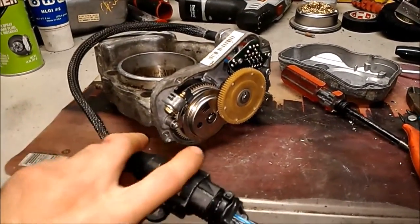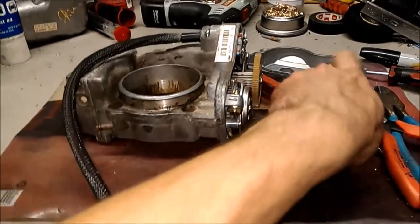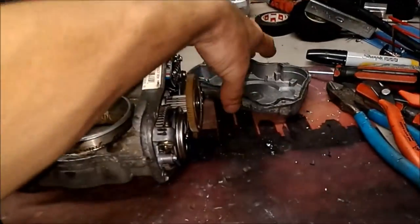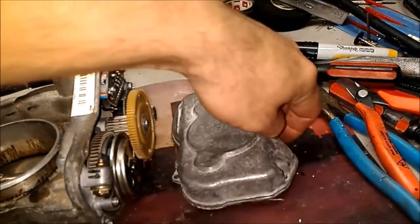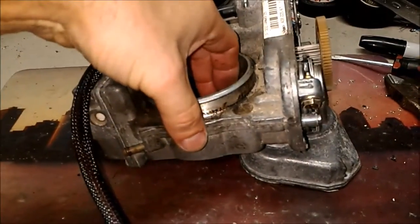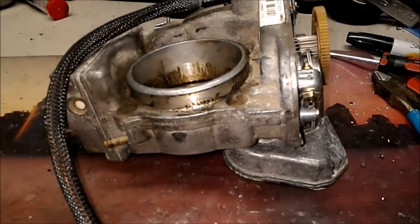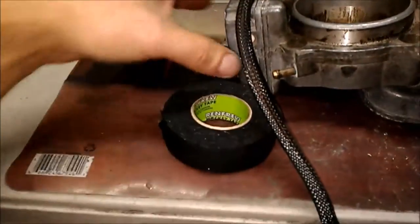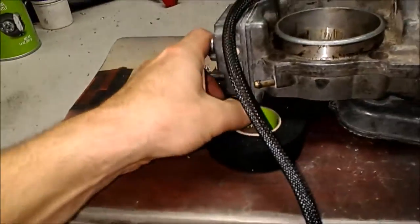Because when it's not soldered correctly or there is a short in there somewhere, I'm just wanting to confirm the problem. So this is the purpose of this video — this is the first video and I'm going to combine it with the video after. What we're going to do here is, because the throttle body is going to jump to open position, I'm going to put it down like such and make sure the plate is not going to touch. Let's put some tape over here, make it sit on the tape.